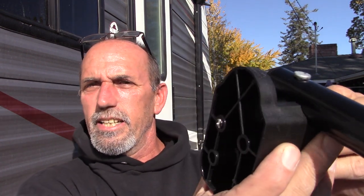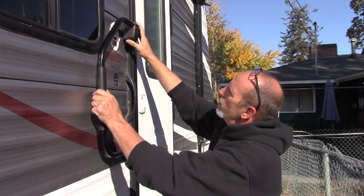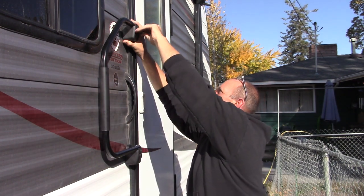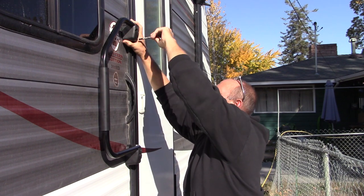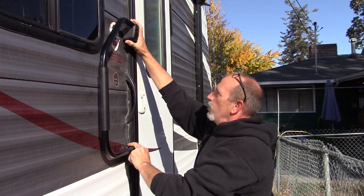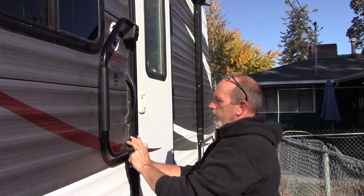What I've done is I've taken a drill bit and added a little bit of tape to it to take up the slop in that hole, so I can precisely mark where I want to put the hole through the siding into the stud. The drill bit I'm going to be using is a one-eighth inch. So, line it up where I want it, take and put that drill bit in there, and twist it. Hopefully without moving the upper one, I can get in here.